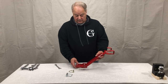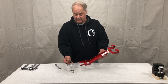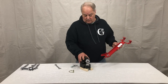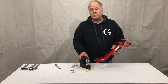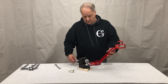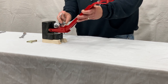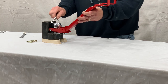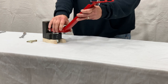Now we're ready to assemble it and put it on our car or vehicle using our 3/8ths pin. This will mount to either an inch and 7/8ths or a 2-inch ball. When you have it, tuck up underneath the ball and slip your 3/8ths pin in between the two rear holes of the ball mounting bracket, and pin it in place.